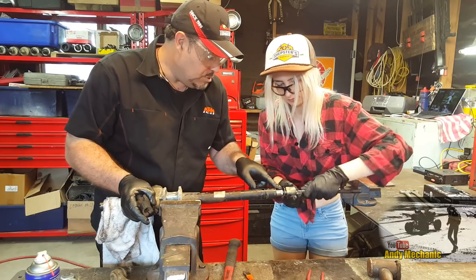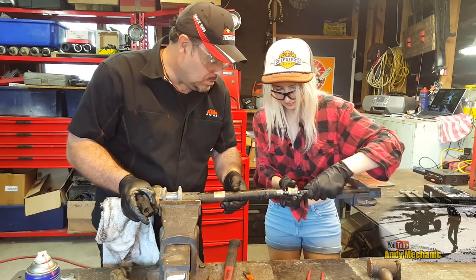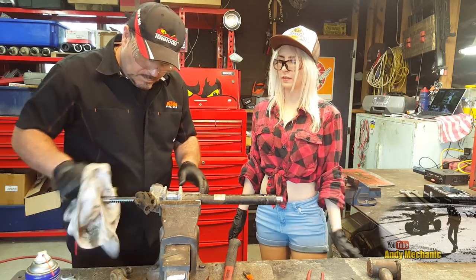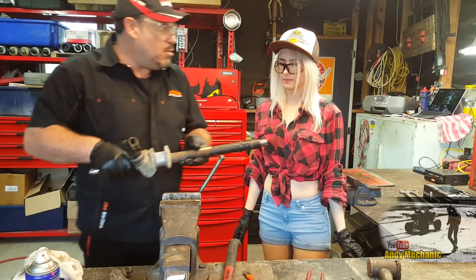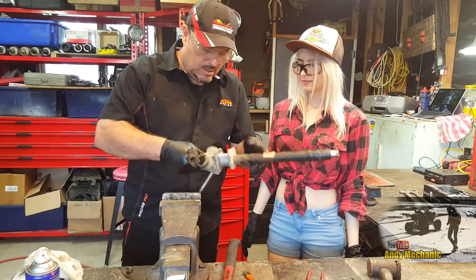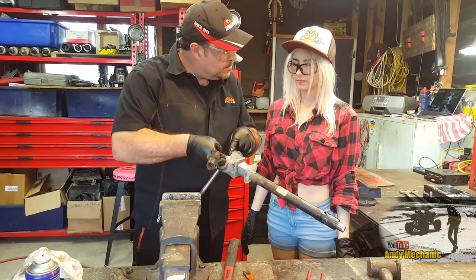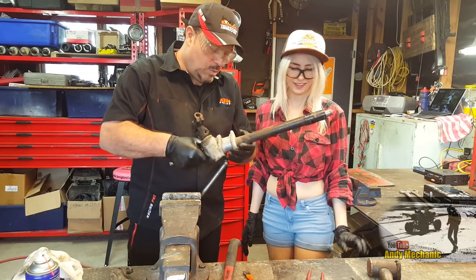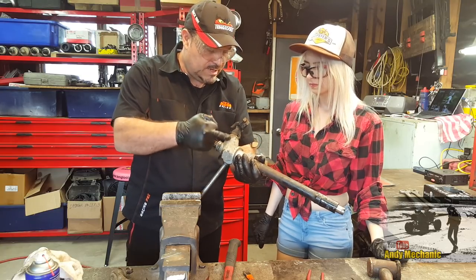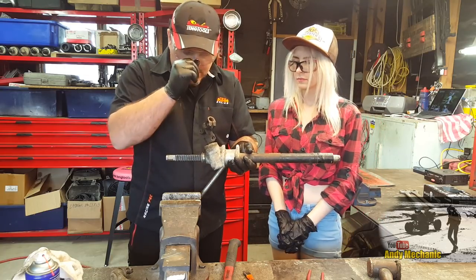And you can see why these washers are used once, because they get really chewed up and they have little lugs that stick in the end of the rack and all sorts. Cool. Perfect. Right, so it's now suddenly become a manageable size. We can cope with that, can't we? Yeah. Okay, so next is going to be this. And this is what we call the yoke, inside there. And it's not an egg yolk. Yeah. All right, and all it's doing is it's pushing against this shaft. It's pushing it towards the teeth on the pinion to make sure that there's no backlash. Now, remember on that, I'll get rid of those again.